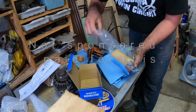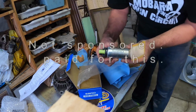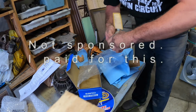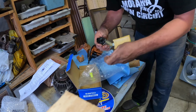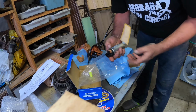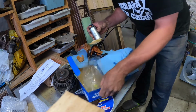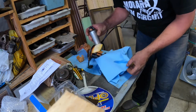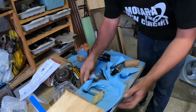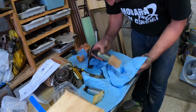The pump we'll be using is a Sard 130, 130 liters per hour. And the reason for that is because this is the one recommended by Monster Sport for the Cappuccino. And I figure if it's good enough for a Cappuccino, it's good enough for this application. So we're running with this. Feel free to disagree. Just leave your disagreements in your own head. We don't really need them in the comments.